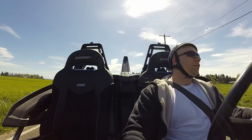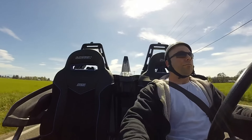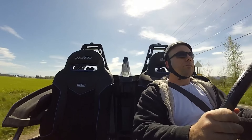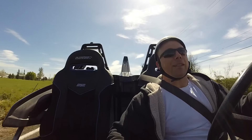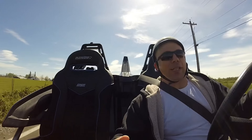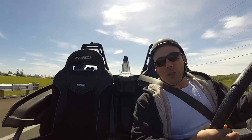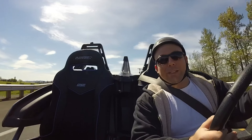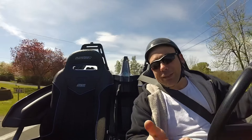I'm going to try it with a launch this time. It's a little better, but she really still likes to spin. I'm using stock Kenda tires that are worn and I'm on the street, so with a stickier tire on a track surface it's going to be a little bit better. But don't expect that because you buy these shocks and set them up for drag racing, you can buy a turbo and a stickier tire and just hook up like glue — it's probably not going to happen, but it is a little better.